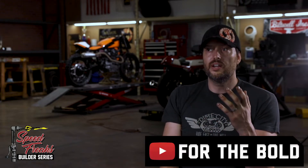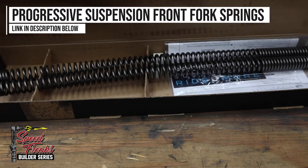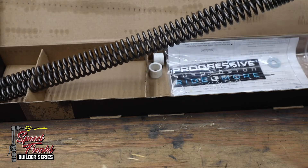The forks, obviously being standard CX forks, they're not the best, so we fitted these with some progressive springs. The progressive springs eliminate those two separate springs — a little spring, a little dampener, and the main spring itself — replacing them with one spring that fits straight inside. We're also going to be using a little thicker oil to make that shock a little bit tougher.